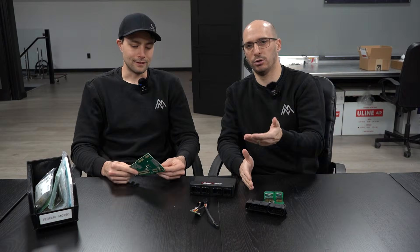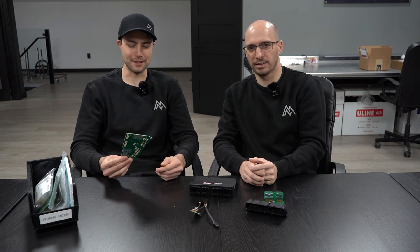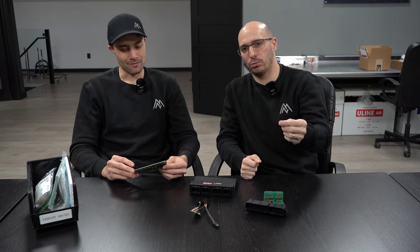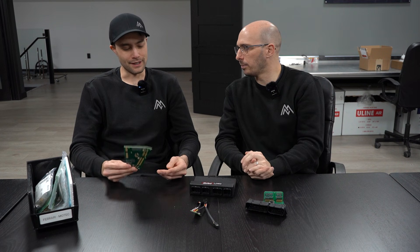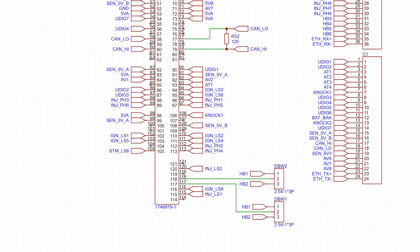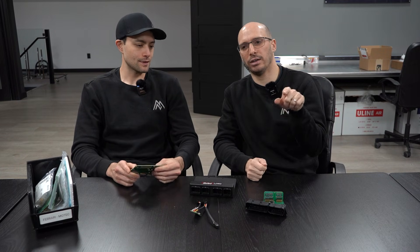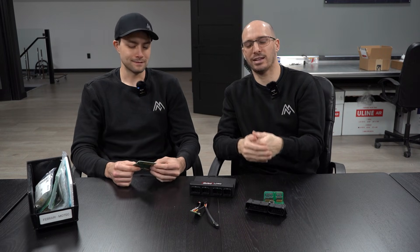The challenge is if you make a mistake, you need to make a new PCB — you can't just change the wire. Using wiring diagrams where you go to a different page and the wires are not the same colors, you just have to make that permanent in your new board and hope for the best. But we did test — we went through and checked whichever cylinders we could easily reach, checked most of the signals. We almost totally nailed it, except for the drive-by-wire, which we knew we didn't have. So we put jumpers to be able to switch — it was a 50/50 shot and we were definitely wrong, so we flipped the jumpers, no problem. If we make newer versions we can make that permanent. I also forgot to wire in the ignition switch signal to an input, so the ECU keeps itself alive but then doesn't know when to turn itself off. But otherwise it was really good.